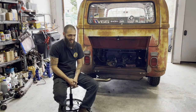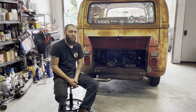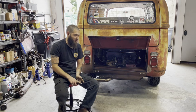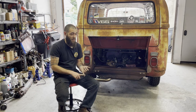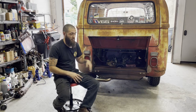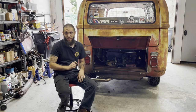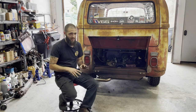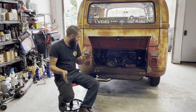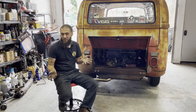Obviously I didn't finish it last night either. It's now Tuesday morning. I've bled the brakes, secured the chassis wiring, I've kind of did some timing and tuning. The generator wasn't working. I had to sort that out. Now it is working. The generator pulley keeps loosening up. Almost flew off in my face while I was tuning it. I don't think I've actually fixed that yet, but I'm kind of running out of time for this episode anyway,